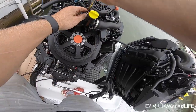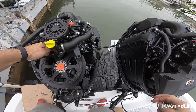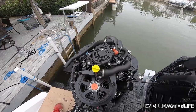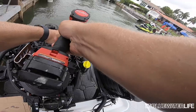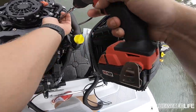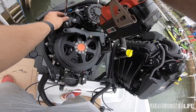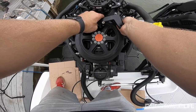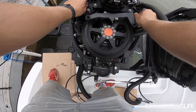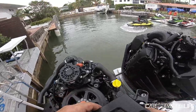Next, loosen the two bolts on the top of the oil fill tube and move it to the right and out of the way so you can access the next piece. Then remove the rest of the bolts holding down the bracket to get it off and access the alternator belt. I did use a screwdriver — they were a little tough so they had to be broken loose, so just be careful. Once you get it off, wiggle it a bit and you'll be able to access the alternator.